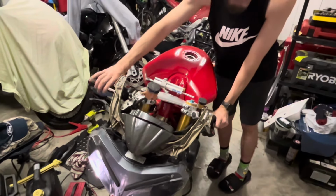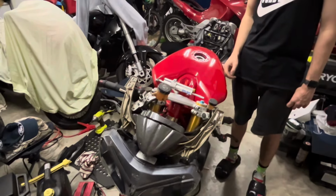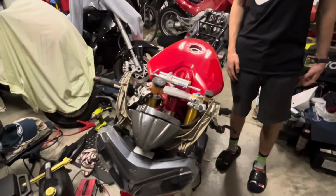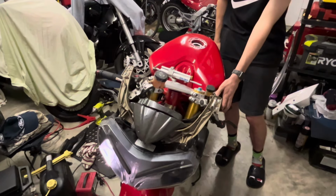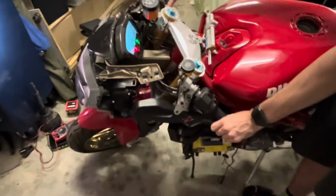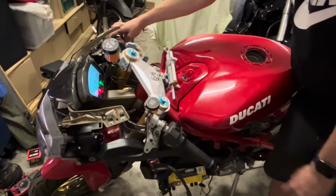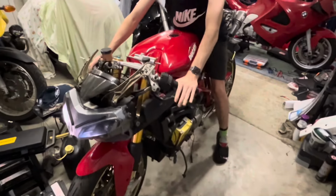So it could be the switch. So there's no errors that time? No. Try again. Nothing coming up on that screen. Okay, so it may not have been the solenoid. Unless it's the kickstand. Well, you can try. It could be a switch, faulty switch in the kickstand.